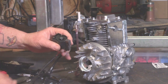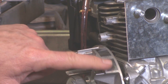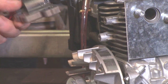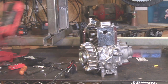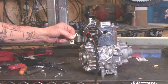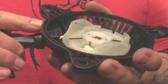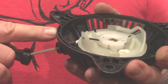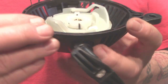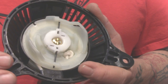Now we've got our magneto CDI off. Do we notice any problems? Is there any rust or gunk on the two magnets? See the contact points? If we're dirty there, that might be our problem. I don't get a consistent reading because of the CDI in there — the capacitor. Just go ahead and get a new magneto CDI; they don't cost that much. You were asking about how to check one of these rope start mechanisms — that's all there is to it. You pull on it, these two black rods pop up. They grab the teeth on that cog on the flywheel and turn it over. So if it ain't working like you see there, get a new rope start mechanism.